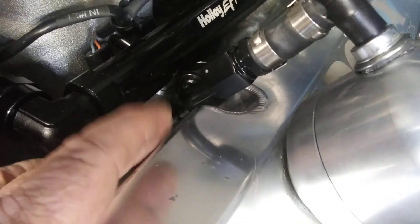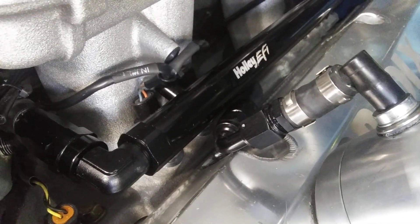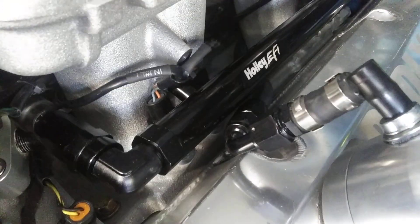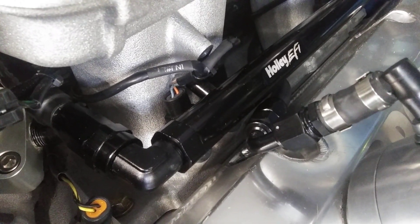Now the injectors — I think I mentioned this in another video — I put them on the other way, because the way these Brodix valve covers are built, they go flush down, maybe even hang out a little more than a normal valve cover, so the manifold wouldn't go on without smashing the injectors. So I was either going to have to get taller injectors or turn them around, which they just fit. I took the locking clip off, and now it's locked between the injector and the manifold.